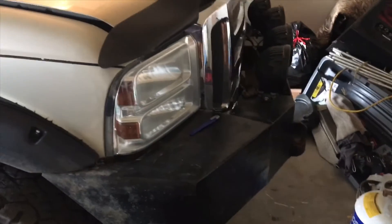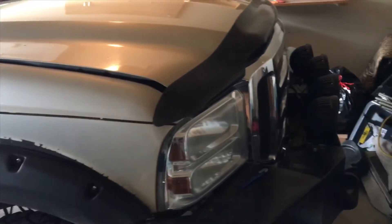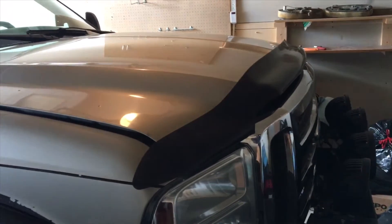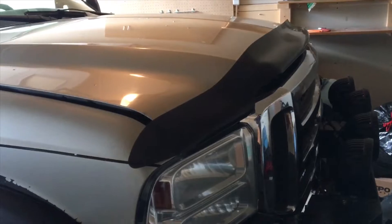All right everyone, today we're doing a coolant system drain — kind of a flush. This is a 2001. Sorry for the trash lighting in here, but I already added some Simple Green into the coolant bottle and drove it around for about 10-15 minutes. So I'm going to drain that and then we'll add some distilled water — you can see the buckets of distilled water I got there.